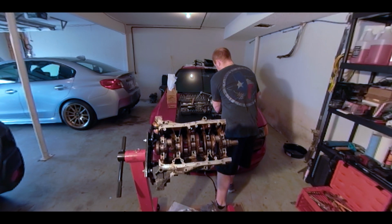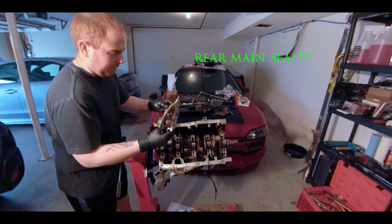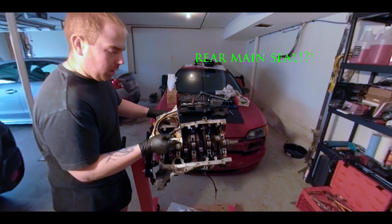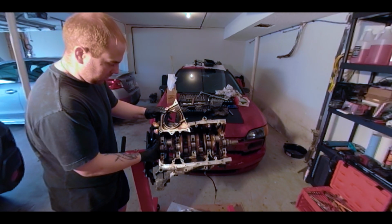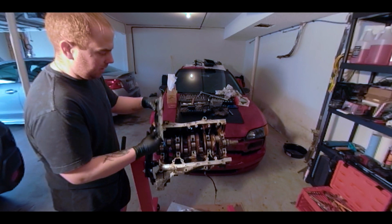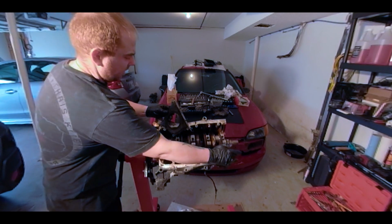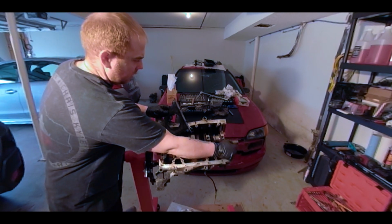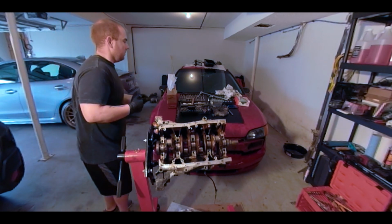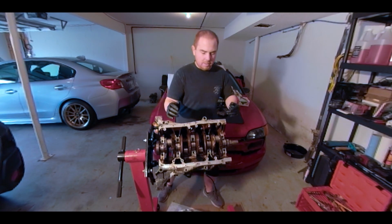And then I had to pull this side off the flywheel side. And pull this side out so it gets out of the way of this. Like I said, there we go. A few alignment bolts. This side were 12s up here, 10s everywhere else. These were all 10s. Alright, same thing. Put your screws in a bag and all that.